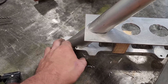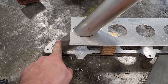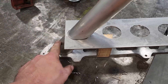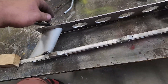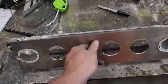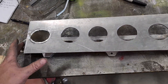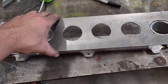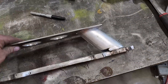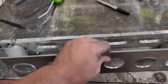I measured and I think this should clear, but that's why I'm only going to tack it — I'll tack the front and the back runner together and go test fit it. I'm not 100% sure how close the alternator is. Got the front and back runners in, looking pretty good — just tacked for now. I had to massage the holes a little bit, and the front might be a little farther forward than it needs to be, but I can fill that and massage the edges — it should be fine.